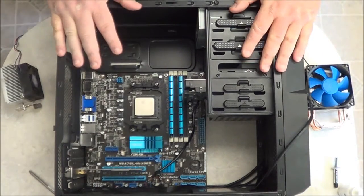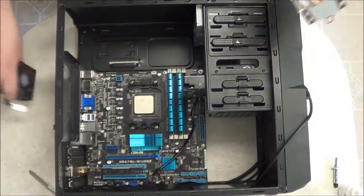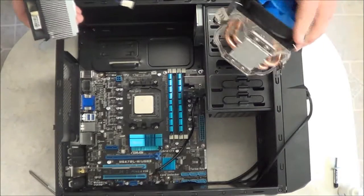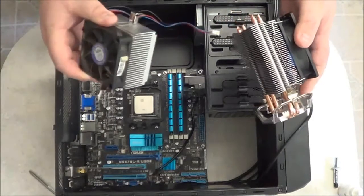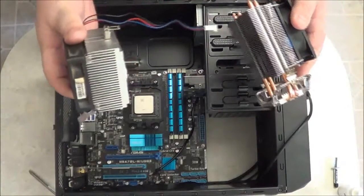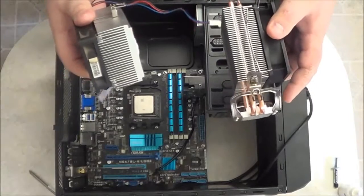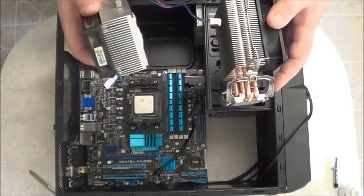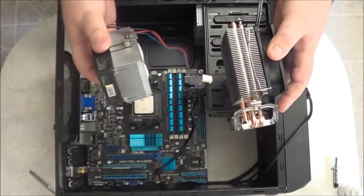In this series of videos, I'm going to show you today on hooking up CPU coolers on a processor. As you can see, they come in different sizes and different shapes. These are typical heat sinks that you'll find — this one here came from an AMD Sempron. Depending on how much heat they produce will determine how big the heat sink needs to be. Processors can run anywhere between 65 watts all the way up to 145 watts, so the heat output determines the size of the cooler you'll need.